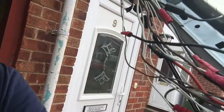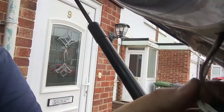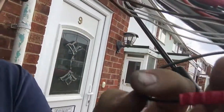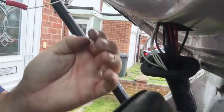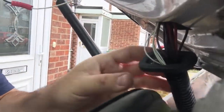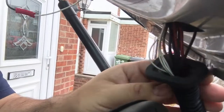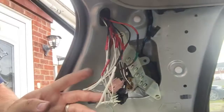So what I did — I cut the wires. I didn't touch the ones that were intact, only the broken ones. I pulled them out, cut them, and joined them with new wires. You don't want to solder the wires here because as it moves when you keep closing and opening, the solder joint will break. The best thing you can do is cut the wires inside the vehicle.